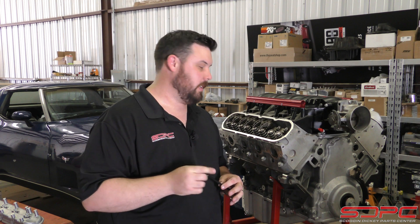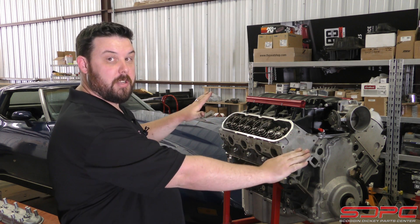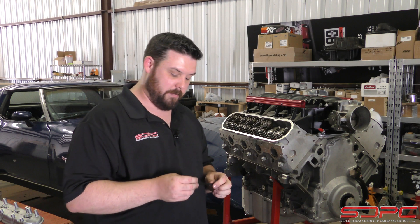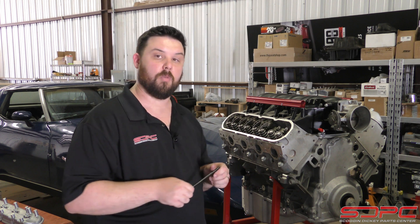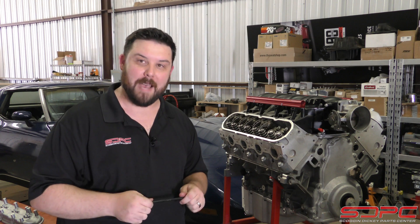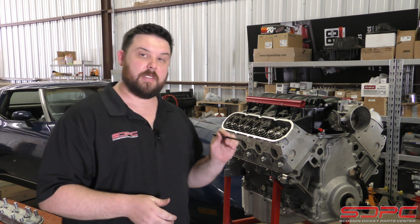That was the intake — now I've got to check the exhaust as well, and I also like to check the corners of each of them. I have had it where the cylinder head wasn't machined straight, and that can be a nightmare too — when you find out that one side needs 7450, the other side needs 7300, and even worse, the other side needs a completely different length. So always make sure to do extra checks on this. It is important not only for the condition of your valve train, but I have actually had moments where I accidentally put in the wrong length pushrod, fired an engine up, and it sounded like a broken sewing machine. There's nothing worse than building an engine, putting it in your project car, and the very first thing you hear when you fire it up is tapping. You're immediately heartbroken — you don't know if it's crank, you don't know if it's rod bearings, you don't know what you did. Tearing this back apart when you think you're done is terrible. So check this stuff, make sure to do it right.